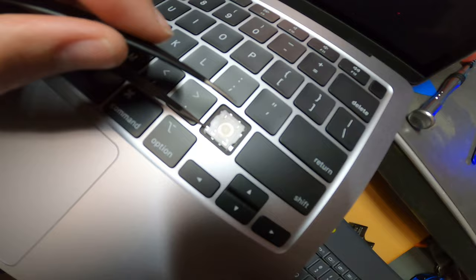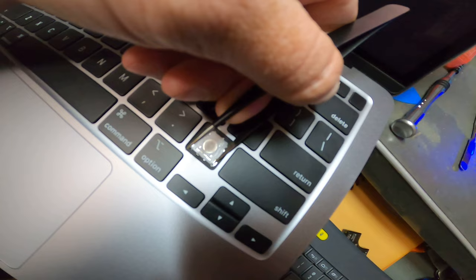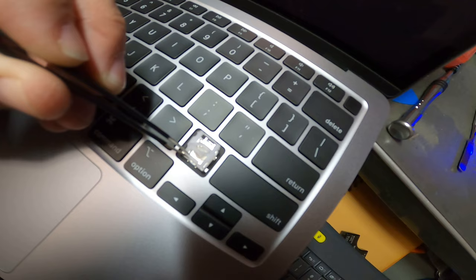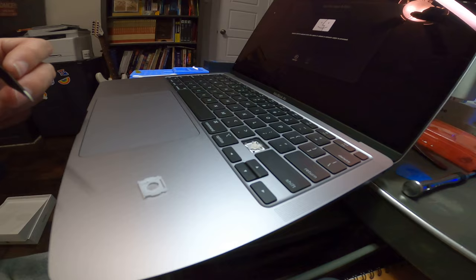See how this piece is now released. I'm going to repeat on the other side. Okay, so now both sides are released. After they're released, the key mechanism should come out — just grab it with your tweezers just like that. Here's the key mechanism right there — actually that flipped over. So now that you have that out...